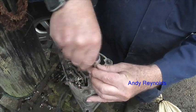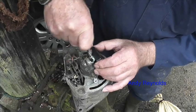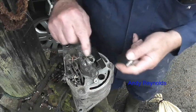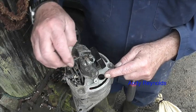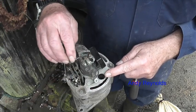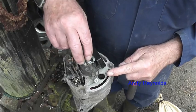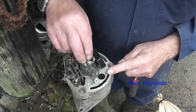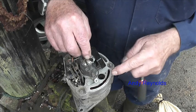Now I'm not sure about the modern ones, but effectively all these alternators have a three-phase output. That is a three-phase rectifier — three-phase variable AC out of the alternator, DC out between there and the earth. And here in this little block there are two carbon brushes that go on the end of the rotor.